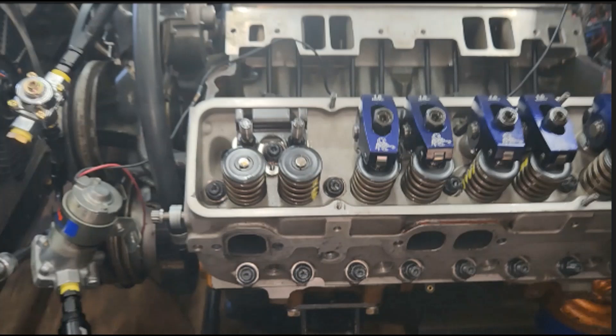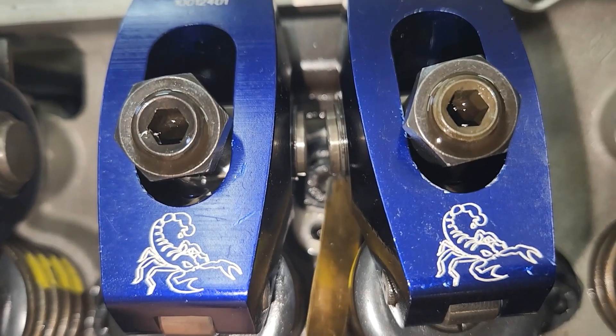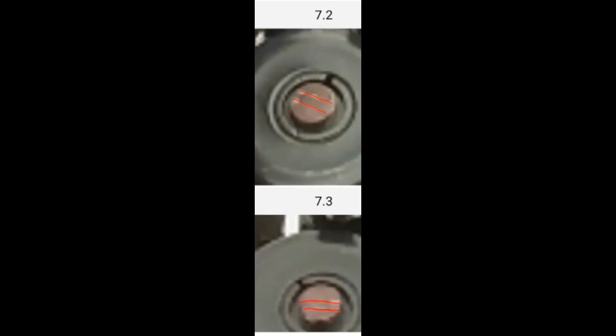Or I could take the heads off and have the area where the nut goes onto the head ground down, and that would help it clear. This is with the 7.2 length push rod that we were originally using. Here's a video of where it's hitting, and this is the clearance it would have with a 7.3 push rod. This shows what it looked like on the valve stem with the 7.2 and the 7.3 using the stock spring. The 7.2 is a little bit short with a thicker sweep, and the 7.3 shows a little bit long but with a thinner sweep.